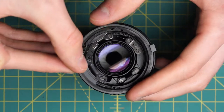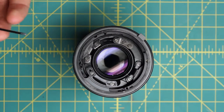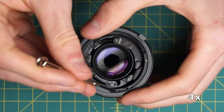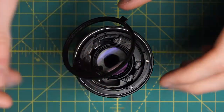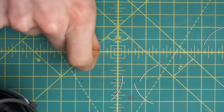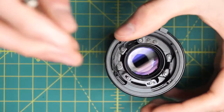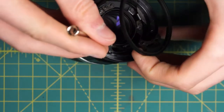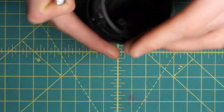You can't actually remove this piece right now, so just set that back down. What we want to do is remove that section with the little ball bearings. First I'll remove the two little separator washers sitting there, and then remove the ball bearings and little separators, being careful not to lose any. Now that we don't have to worry about those, you can see this piece is held in place on one side by a little post, so you can't remove it yet because the post is looping over the section down there.